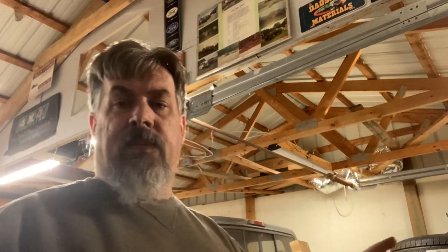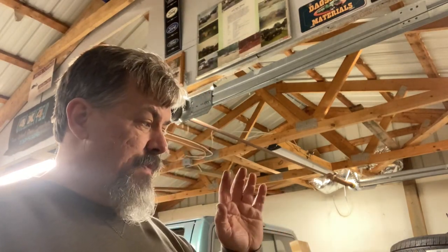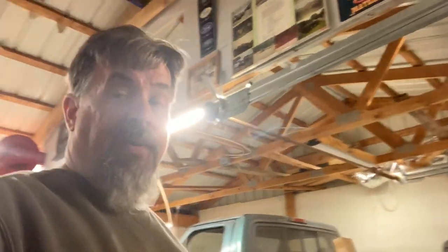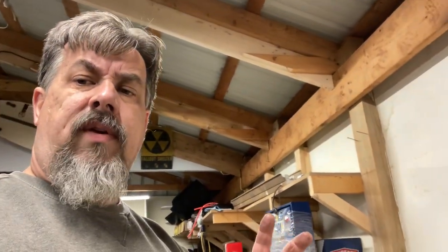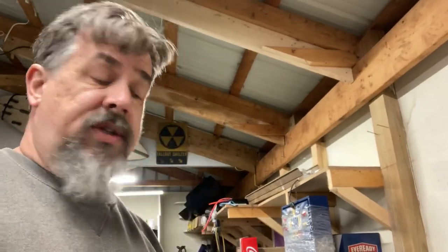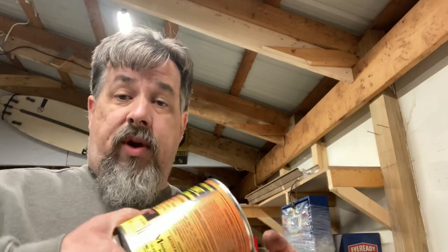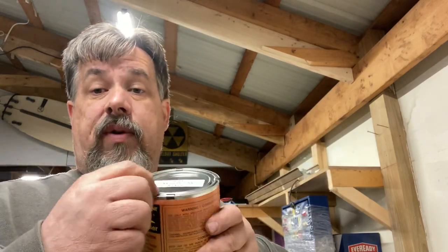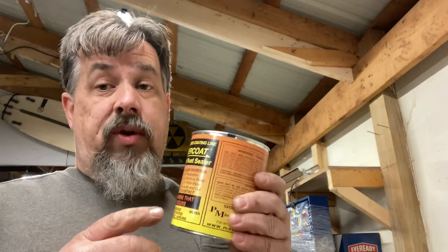They're going to get top coated with some kind of enamel, just automotive paint. The main reason I sandblasted and cleaned them up was because they were so rusty and dirty. This silver paint is worth the money — it's about $56 to $58 a can and you can get it on Amazon. A tip: if you get this stuff on your hands it'll wear off, so use rubber gloves. Also, if you pour some into a smaller can to work from, do not put the unused portion back in the original can. Do not get any silver paint on the lid or you will not get the lid back off — you'll destroy the can.